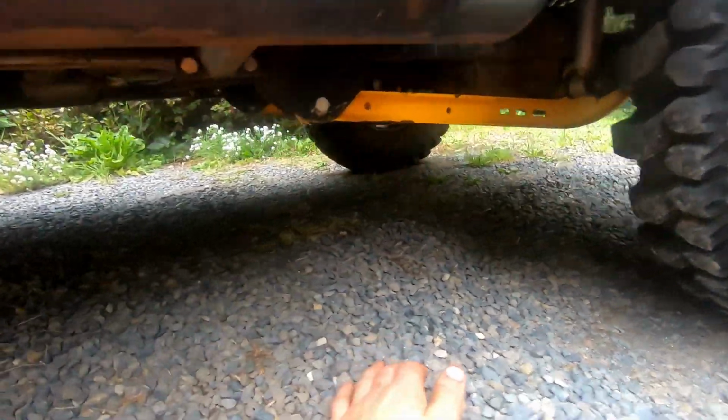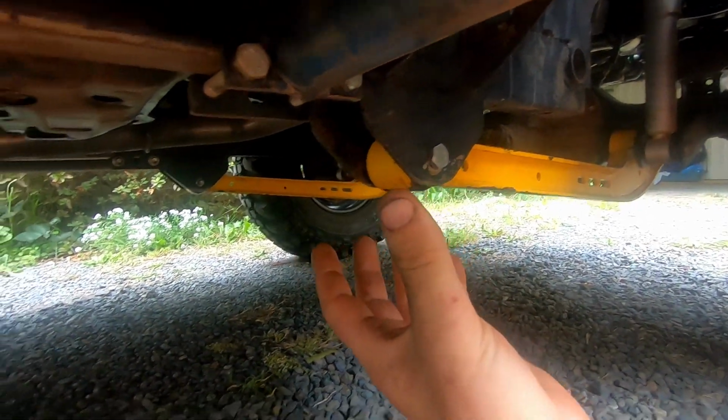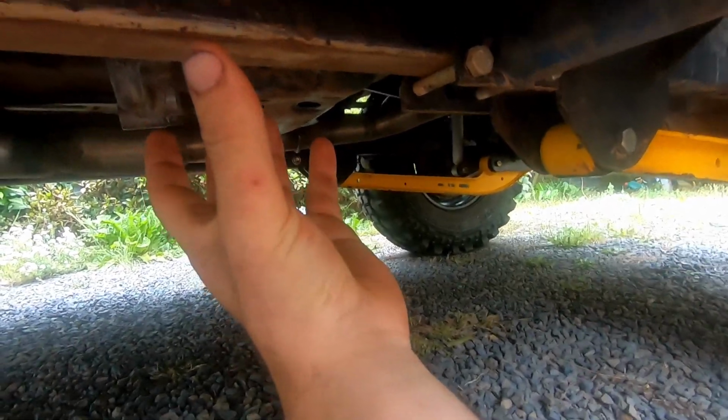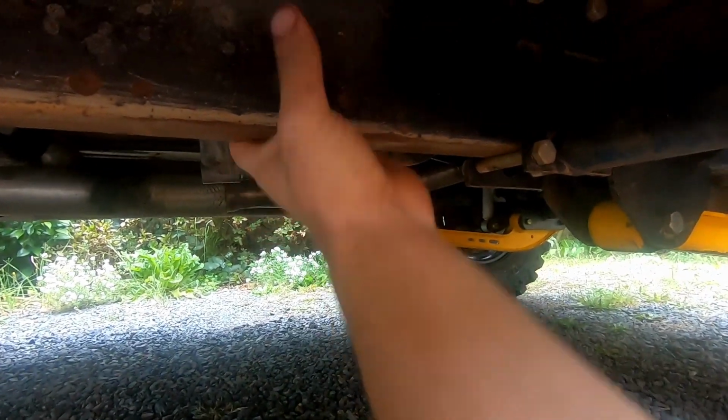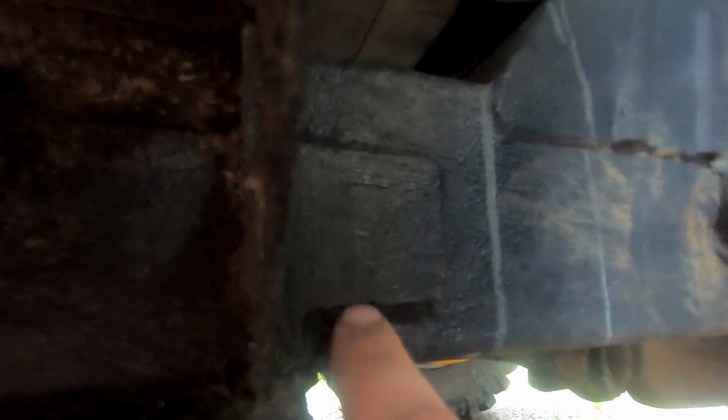And the rear radius arm mount is just a C channel that we've had folded up that wraps right around the chassis, and then we've mounted our bottom radius arm mount to that. As you can see there, I've painted it so it's hard to tell, but we actually had to cut all the way up this body mount here, and then same with the other side, and then push the C channel over and then weld it all in.